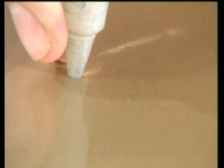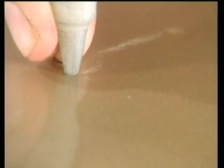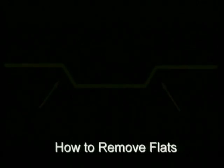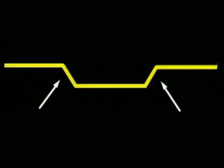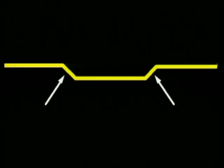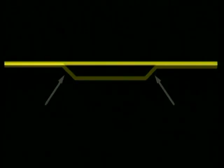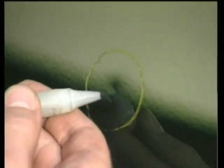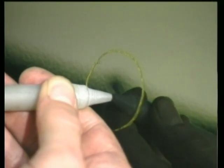Following the contour of the crease, use the punch. Tap the crease slightly two or three times in each spot, and overlap perhaps five or six punches per inch. This depends on how steep the shoulder is. For an average flat, knock the shoulders down first, using your punch and the clock method to smooth the curves of the dent. Then tap the centre of the flat gently and clock it out from underneath. The resulting shallow dent can then be removed in the normal way. Sometimes you will be working a dent and it will split into two dents — this probably means that you went to the centre too soon and pushed too hard. Knock the centre back down with the punch gently and start again in the normal way.